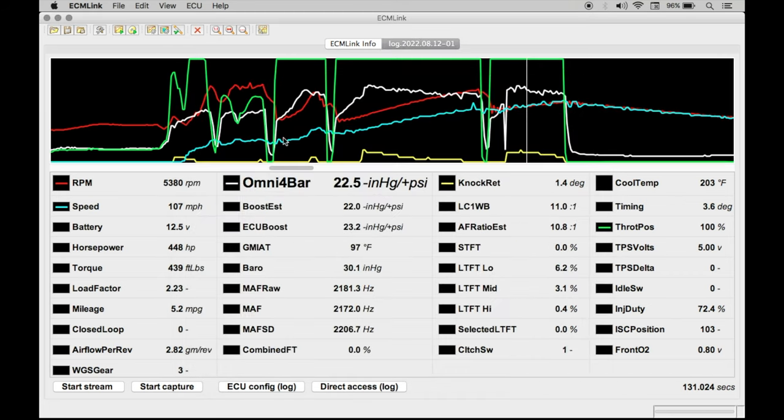Better? Now, immediately, the green throttle position line says that my foot's all over the place in first and second gear, trying to gather it back up because I'm not in the groove. I backed off in first, trying to reel it back in, kind of saved it, then totally lost it all again and grabbed second. Broke traction at only 3 PSI. I'm launching with zero. This car makes as much as 8 whole PSI in first gear, and that's it. And it can't stick it either.